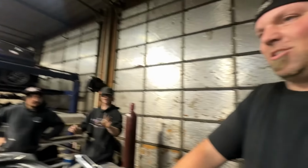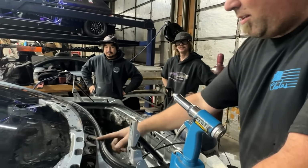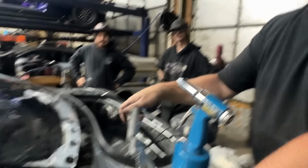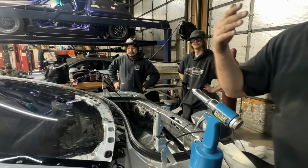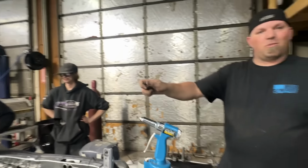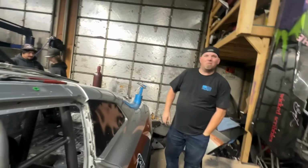Yeah, it's a two-person job. You know, they're a finger-length apart. So when you drill, especially if you're using glue, if you have somebody with an air blower, then the metal that's coming out with glue doesn't stick to the window. Otherwise, when you wipe it, you scratch the crap out of it. Yeah, blow it away. So if one person's drilling, the other one's blowing, and then does the rivet. Awesome. Works out good. While you're doing that, I got the column kind of to length.